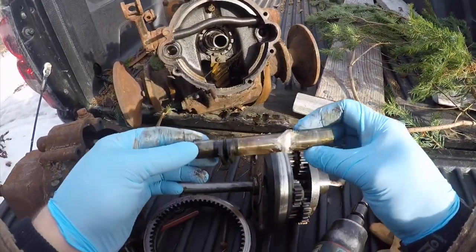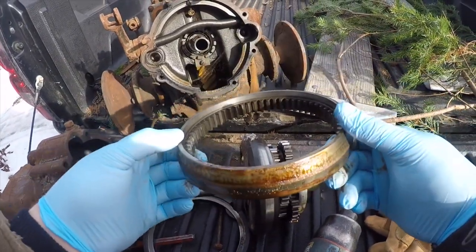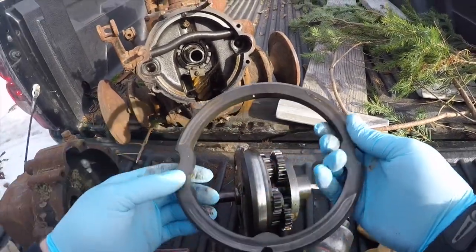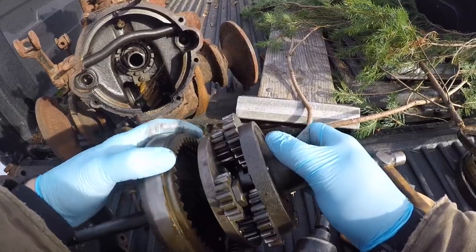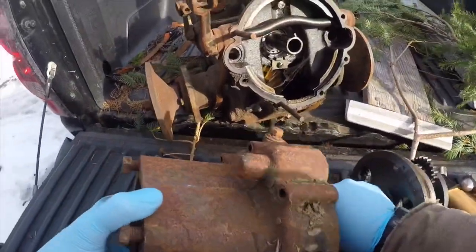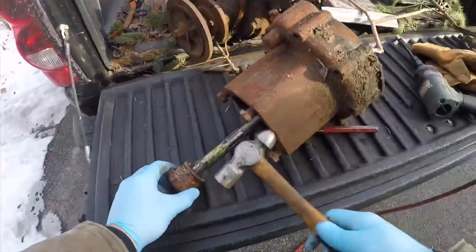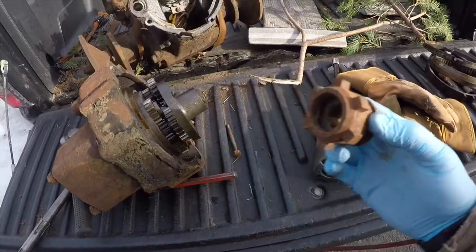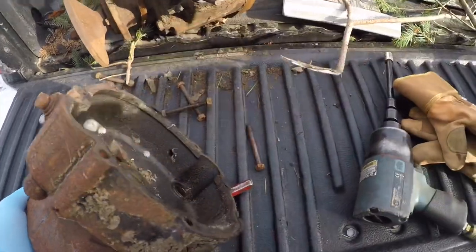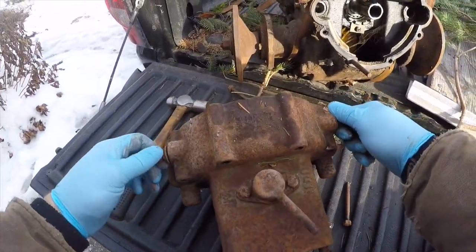Everything looks nice, as if it was meant to mesh together with no problem. The clutch sliding pins are good but I've already got about 20 of them. This planetary gear looks brand new — really no wear on it at all. That side looks nice too. The shipper shaft is kind of stuck on the end with rusty junk, but a couple taps and the dog gear comes off. The planetary is pretty nice, the housing is good, and all the bolt holes are intact — a lot of times those handlebar bolt holes get stripped, so we'll probably save that.